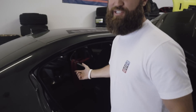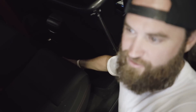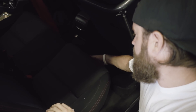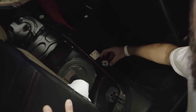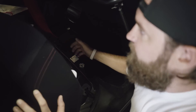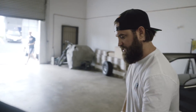We're gonna start with removing the rear seat, and that's pretty simple. If you reach under — basically in the sedan, which is different than the hatch — there is a release. You just reach in here and pull out and the seat unlatches. There's a spring-loaded release, so you're basically reaching under the seat and pulling on that. At that point you can just yank the seat out, along with all the loose change and crayons Dustin has back there.